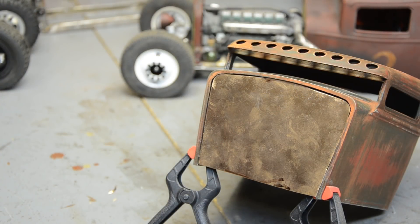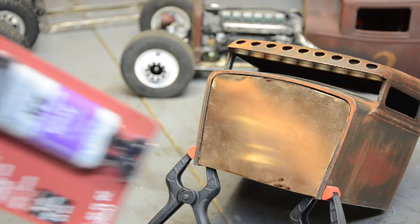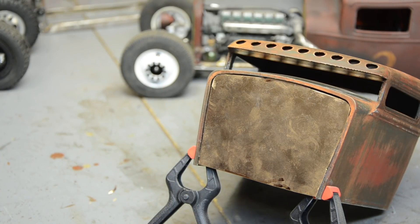So you can see it fits pretty well. There's a little bit of a gap, but it's obvious that's not original to the truck — it's not like a factory firewall that would protrude from the cowl. So I'm happy with it. I'm not sure yet how I want to finish the copper, or if that's even copper. I'm not sure how my rust solution would act on it because it is just a copper-tinted steel. We may have to do some experimenting. We've got to do something to it though, because it's got smudges and Sharpie marks all over it. This will also allow us to push the firewall back a little bit and make more room in the engine compartment. I've got some plastic epoxy two-part glue, and I would use that to mount it — just put it around those four tabs, clamp it, and let it cure. That stuff usually works really well with 3D-printed plastics.